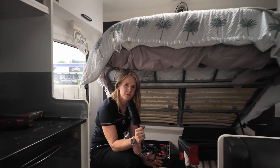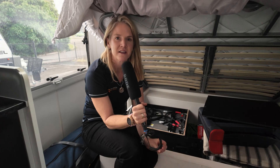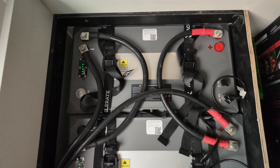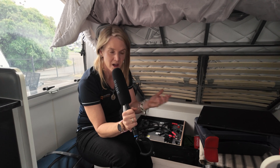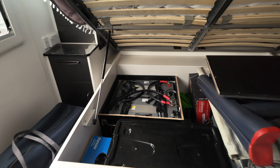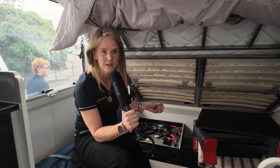The heart and soul of any off-grid system is your batteries. We have gone to lithium batteries in this caravan, so you've got more usable amp hours. There are two 300 amp hour batteries in here and you can use more of those 300 amp hours than you could with other styles of batteries. The Invicta batteries are a lot lighter in lithium as well, so if you're looking at saving on weight you can generally get more amp hours in for less weight.